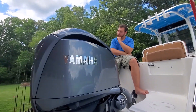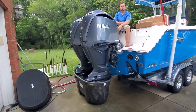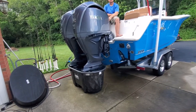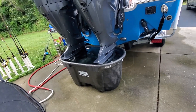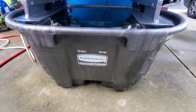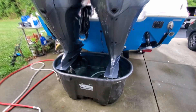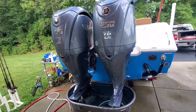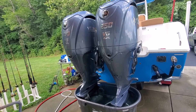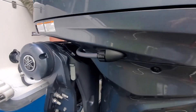We're getting ready to do the oil change service on these things as well, but we're going to give our twins a bubble bath. We got this big old tub from Tractor Supply — it's a 100-gallon tub, and both outboards fit in it right to the cavitation plate, and that's all you need to flush. That way your water pumps can move the amount of water they want to move. These big outboards take a ton of flow, and even one at a time hooking them up to the engine flush connection right here is not enough.